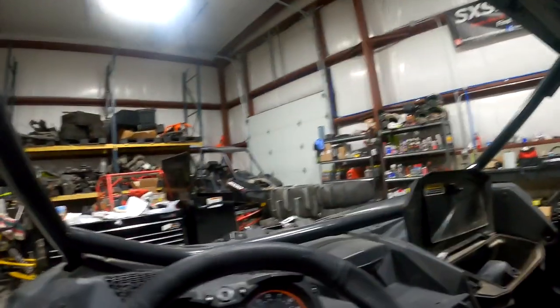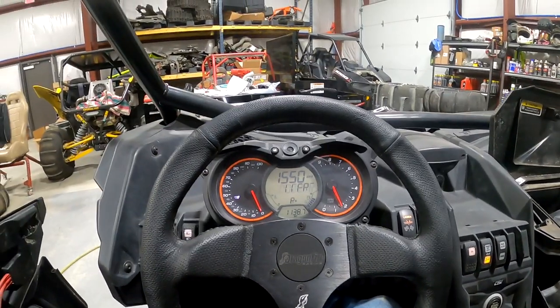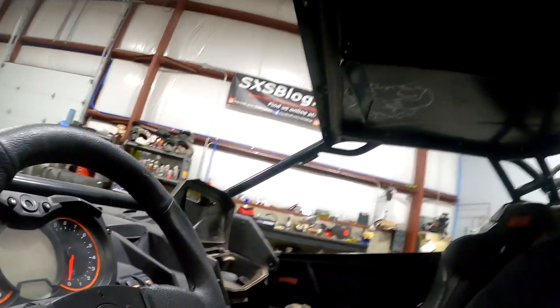So it is a little bit low right now — it's probably 2,400, 2,500. For this application, I'm going to want it up in the vicinity of like 3,500 honestly, because that big turbo is going to take a lot of energy to get spooled up on the line, so I want this thing to be able to leave strong. I'll put the 32s on it eventually and see what it does, and we'll probably have to make some changes to the primary weights, different spring, whatever — all part of the game.